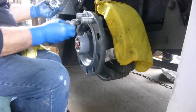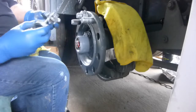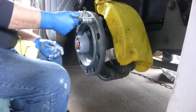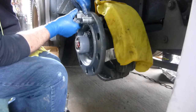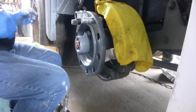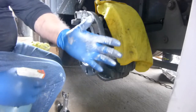Coat that surface and make sure it's all coated so you've got two slippery surfaces. Take the best old nut that didn't wobble on the old studs and put compound on that surface too. Don't run it down with the gun right off the bat because you don't want that washer spinning around. If it does start to turn, the flat will hit the radius and stop it. Before using the gun, get in the habit of cleaning your hands - look how gunky these gloves are.